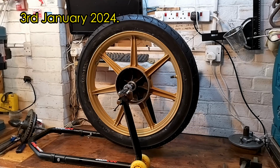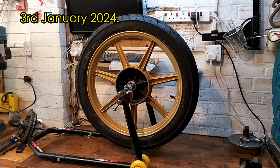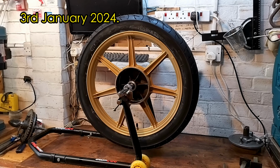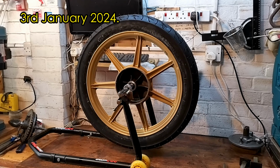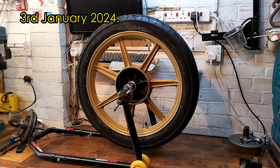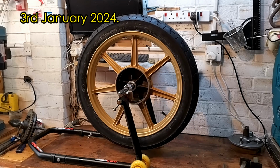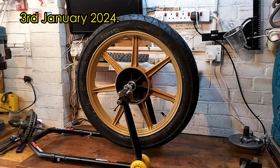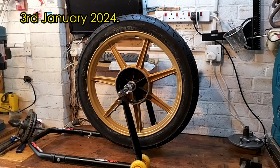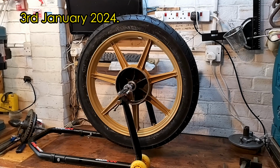It's a little time consuming. You just have to take your time while the wheel settles itself and then apply the counterweights on the opposite side to the heavy side. Go again, keep going until it stops anywhere instead of sinking down. And that's the front and rear wheels finished, painted, tyred and waiting to go on the motorbike.